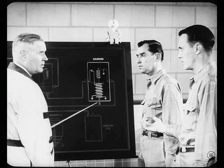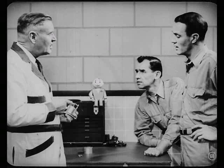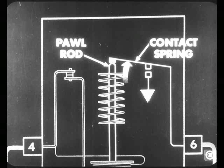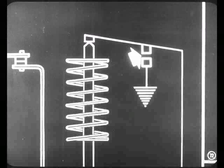So we have to relieve this torque so that the pawl can be withdrawn. We do this by interrupting engine ignition for an instant. When those B contacts are bridged, current flows from the ignition coil across these B terminals in the kickdown switch to ground in the solenoid — and that action interrupts engine ignition. As torque is relieved, the pawl is pulled out of the sun gear control plate by the action of the return spring. The pawl rod pushes against the contact spring at the end of the solenoid. This contact spring has one of the ignition ground points — so when the pawl rod pushes against this spring, the ground points are opened. When the points open, the circuit to ground is broken, so ignition current is restored to the engine.